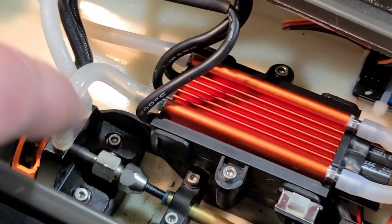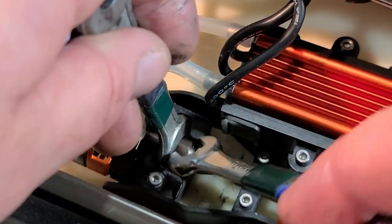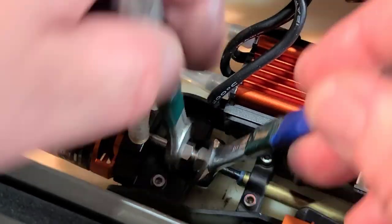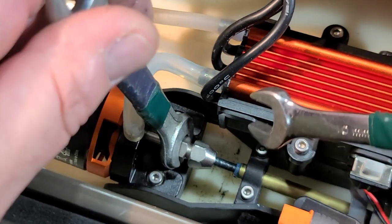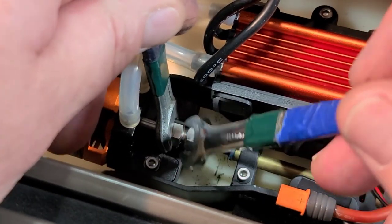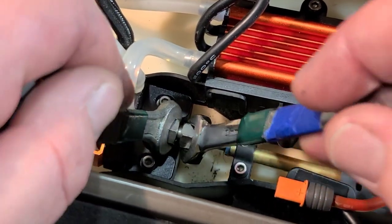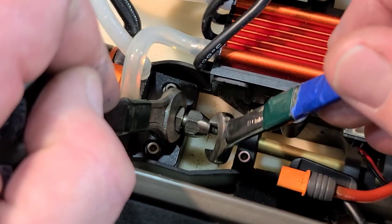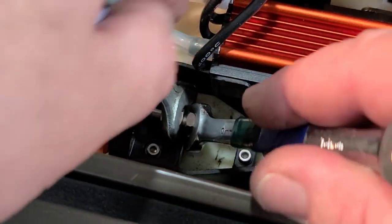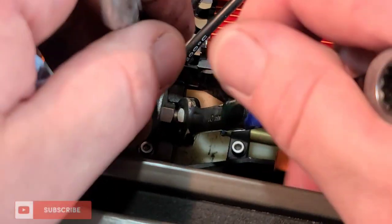Push the cable into the boat and tighten down your collet. You don't want to tighten it too much — just get it good and tight, not super tight. If you get it too tight you could strip the threads on the collet nut. Over-tightening also compresses the strands on your flex cable, causing premature collet wear. If the cable gets compressed, eventually the collet will only get so tight and will start slipping — you'll have to replace both the collet and the cable. Once you get it tight, don't back it off — just tighten and stop.